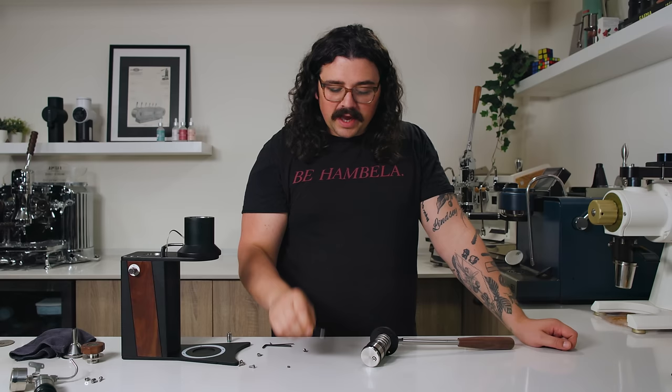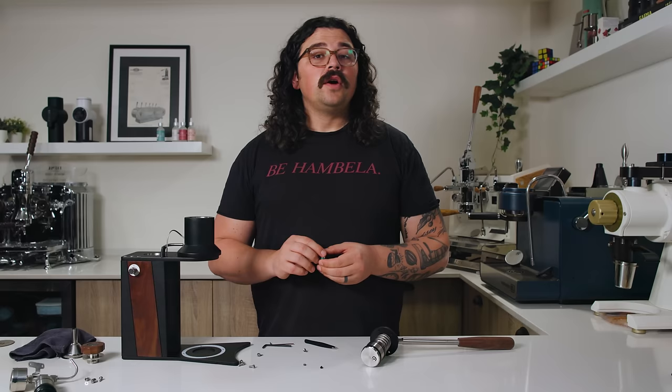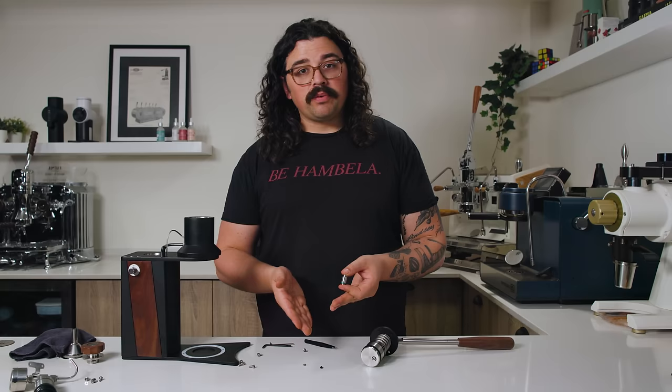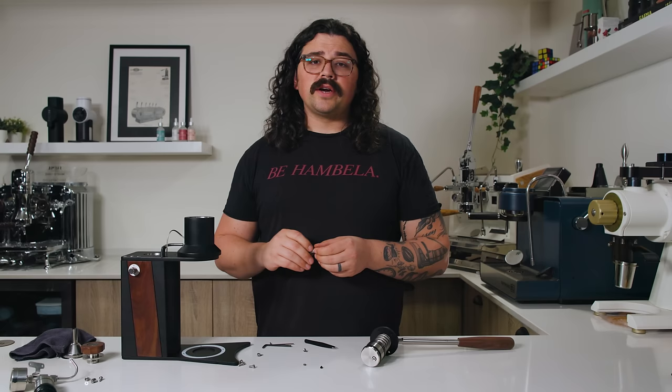So we're going to just put it back to what it was at stock, what the first batches saw, which just has this with a little spring inside to help the water get into the chamber. I'll reassemble it all, and then we'll pull another shot and we'll look at how that Fellini is affected by the lack of a flow restrictor, which is funny because this was an improvement, but I kind of prefer a higher water debit and I would rather just rely on my own ability to get out that air prior to going on in order to get that higher water debit.